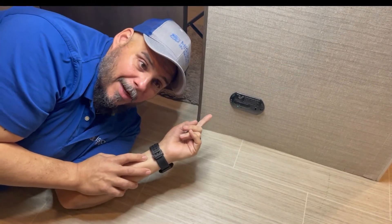Today's case is that this detector is right across from a shower that's not used. This particular rig has two bathrooms in it, and the shower is used as storage in the front bathroom, which is right next to this detector. The reason I'm down here on the floor is because — let me tell you, I got a whiff as soon as I laid down — there is a biological odor creating a gas, a biological gas floating over from this shower stall that is causing this to go off. It's from the gray tank. You might say why is my gray tank doing that? Biological food waste in gray tanks can sometimes be way more stinky than anything that comes out of a black tank. Those who have been around RVs long enough know that is a fact.